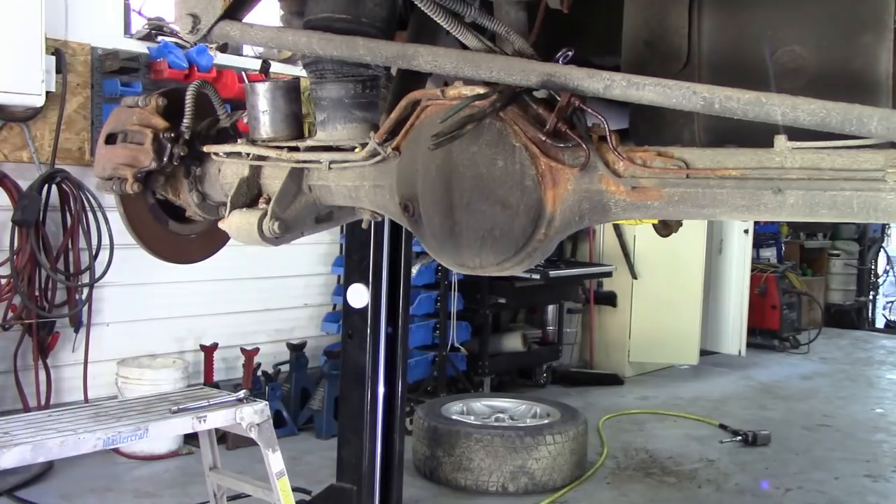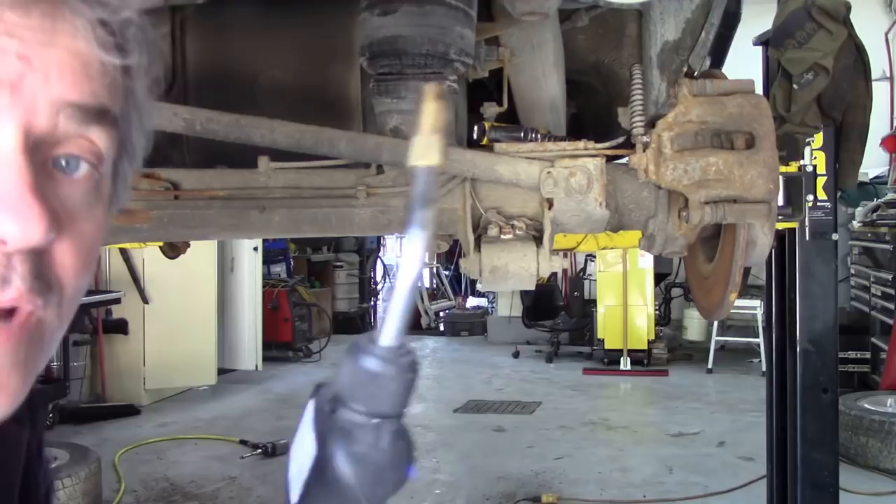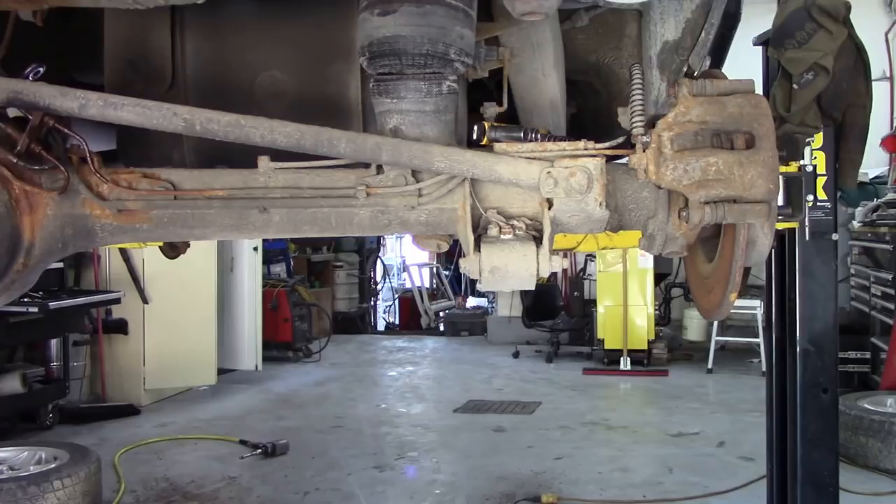Or heat. Even in the calipers. If you've got a sticking caliper, the last thing you want to do is heat the rubber inside. So if it's just bare metal - metal to metal - like you're trying to get a screw out, you can warm it up. But if there's any signs of rubber seals or plastic, never. You've been warned.